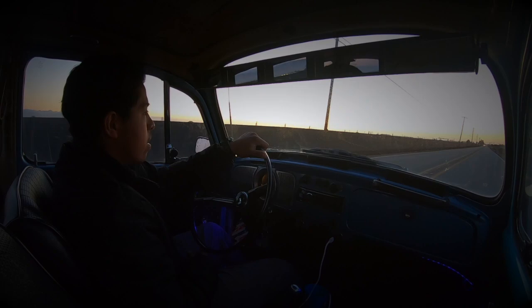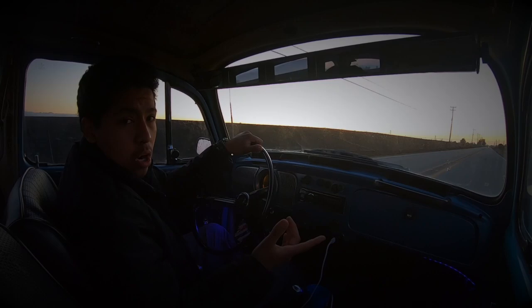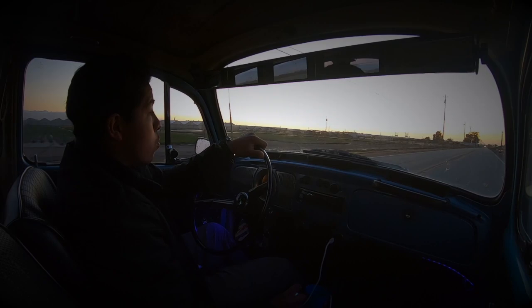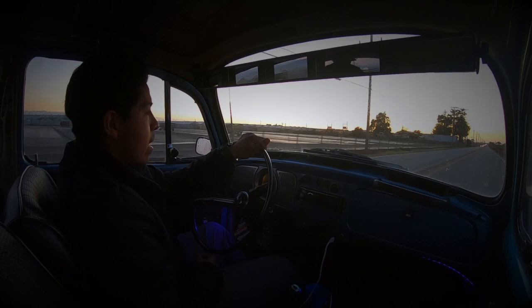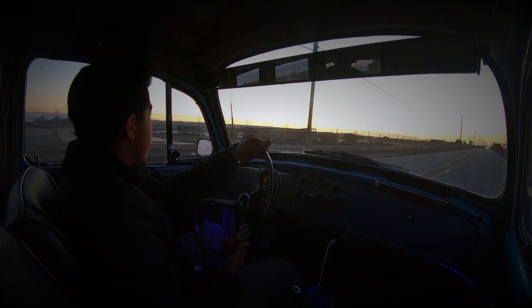Car's running great — super happy with it. The only thing it needs is an alignment, bad. If I let go of the wheel it starts pulling to the right all crazy and the steering wheel has never been straight. I've never gotten an alignment. All the ball joints are pretty much non-existent. I rub pretty bad — going 50 right now and if we hit a bump it's gonna rub, and sometimes I can smell the tire. I run a little too much drop. I might take everything out of the front but I have a spare in there too so I'm just gonna live with it.